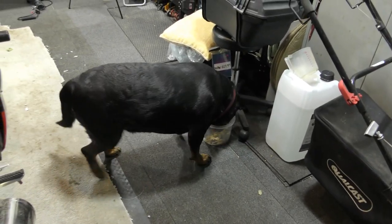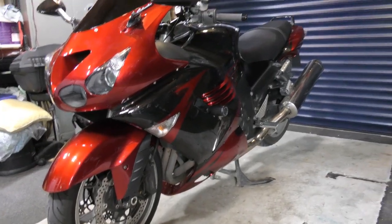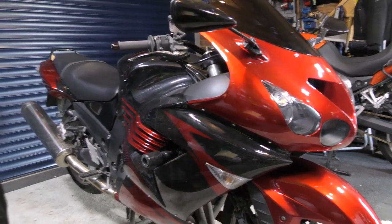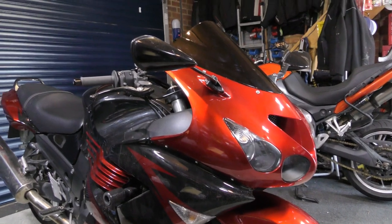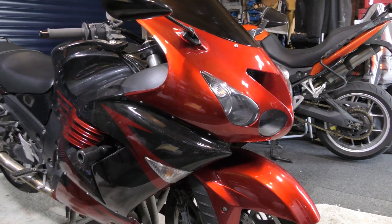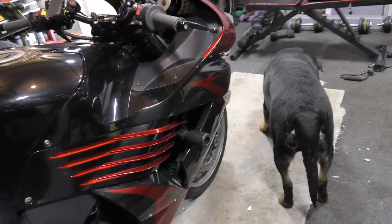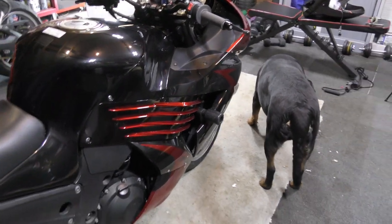This is very pretty but something stands out straight away. It's a beautiful blood red and black color, but these are not the original fairing panels — these are cheap Chinese ones, 360 pounds off eBay. They're not the best, meaning if you push against them they will crack, rather than the proper ABS ones that flex and don't crack. I do love the crash bungs on here — always handy, a must-have on a big bike.